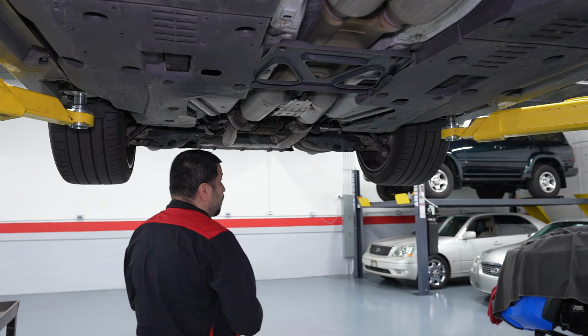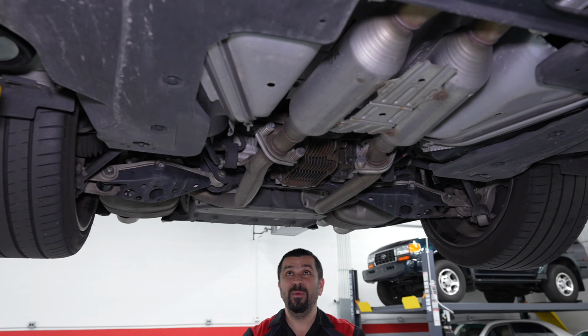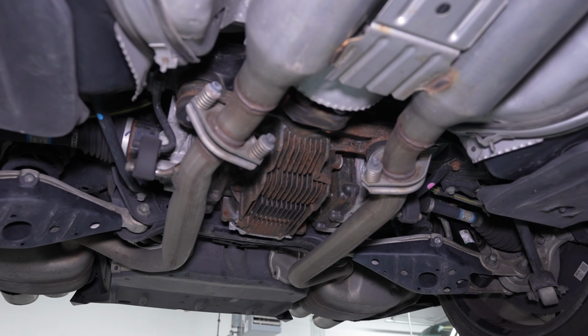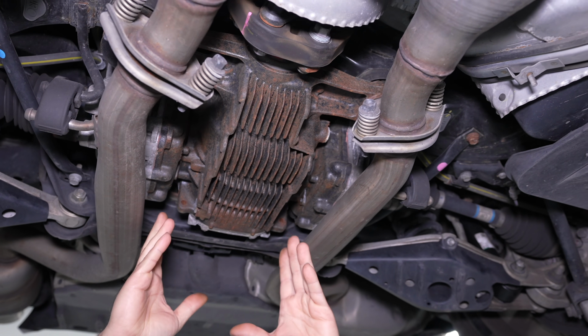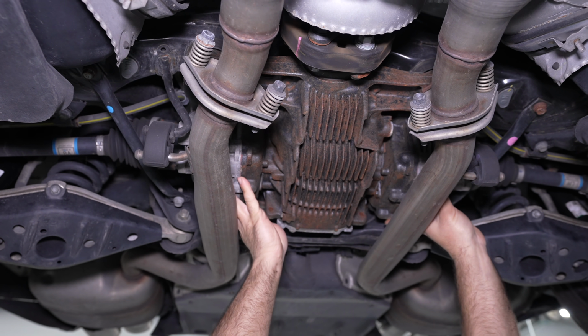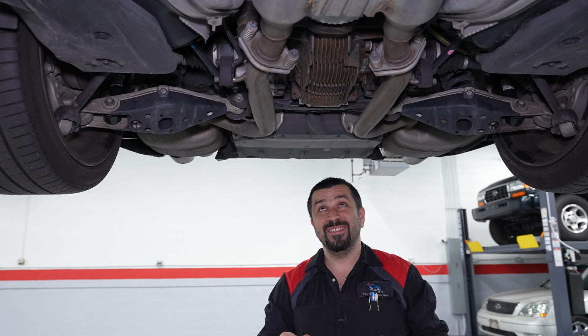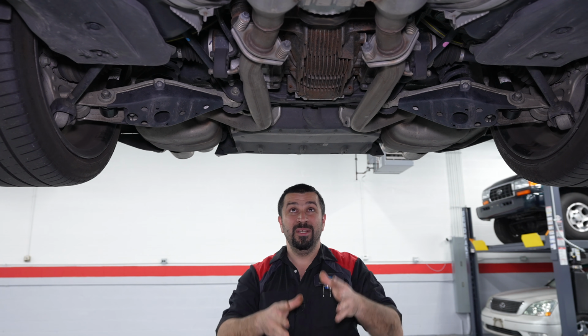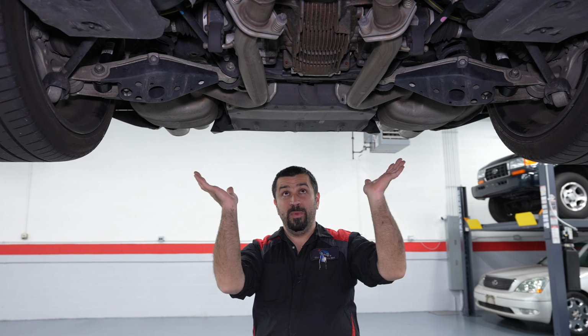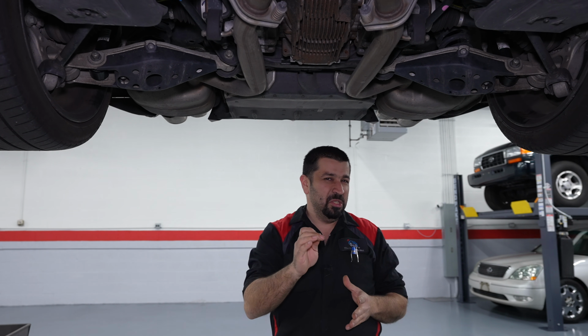And then as we make our way back, we have to look at a very, very big spectacle, which is the rear differential. Look how massive this thing is. And as we get closer to it, let me explain what's going on here. This is the differential, and these are actually 2 side clutches that engage each wheel individually. So the computer can precisely control which wheel is engaged. It's kind of an advanced limited slip differential. It can really let the wheels go and make this an open diff, or it can send all the power to this wheel or to this wheel, and it can control how much power is going where. This is super cool, and I wish more cars actually had this. Performance cars, you don't really need this in a normal car.